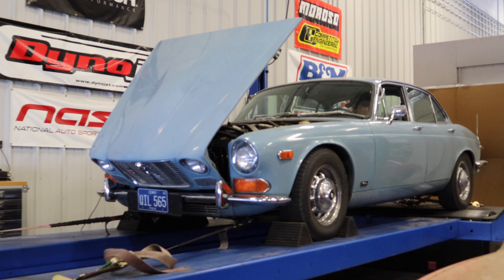The distributor on these cars is in a very terrible spot — you can see it tucked down right there. So in order to get to it, I'm going to remove this bar over the air cleaner and take the air cleaner assembly off, which should give me much better access at the distributor. I have the air cleaner assembly and bar moved out of the way now. There's still not very good access, but it's a whole lot better. So I'm going to get the cap off, take the rotor out, and then remove the points.